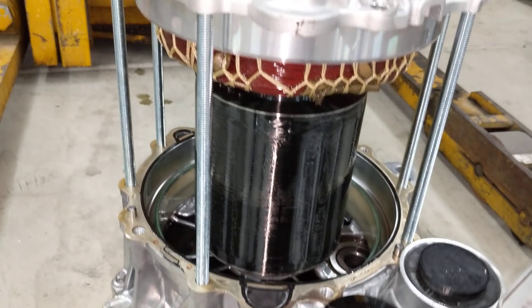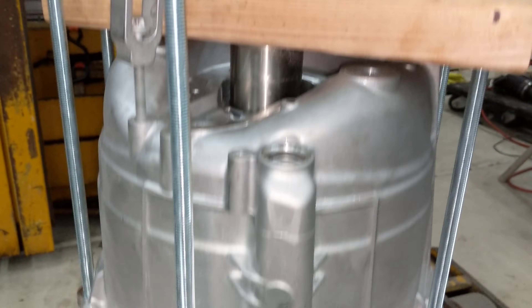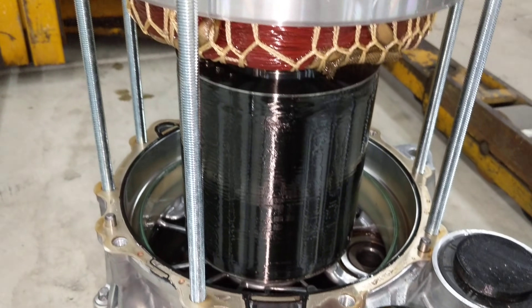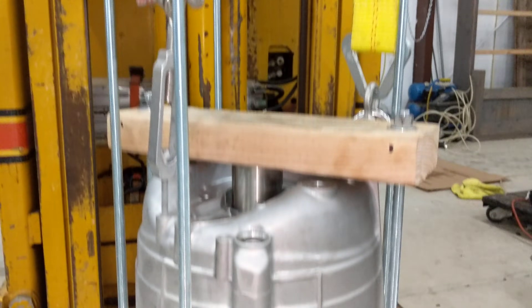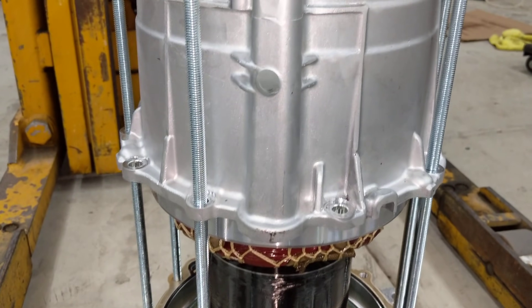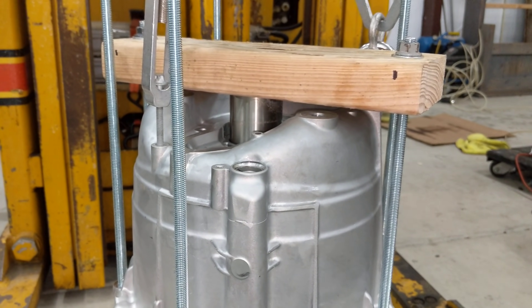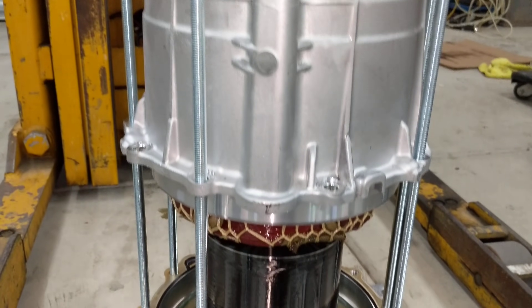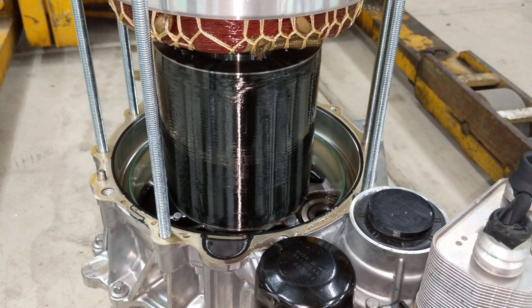What I had to do is make basically a press that pushes this tube down on the rotor and keeps it centered. Then I use the forklift to lift up the field, exposing the rotor. If I want to take the field off I'd have to unbolt this and do a whole dance — it would just be difficult to put back on. So I didn't see any reason to, because I really don't want to wreck this motor. It's otherwise good.